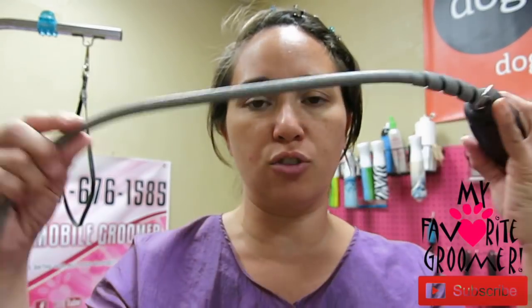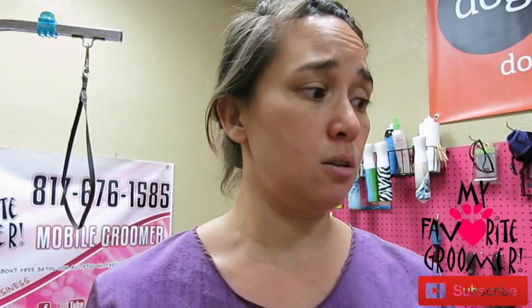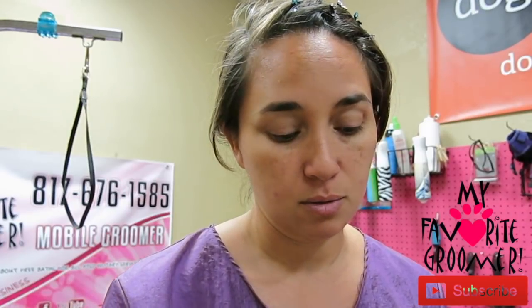I believe in the 5-speed because of the weight and I can get through the day grooming - I have yet to have a problem with any of my 5-speeds. I did take the time to put this original monkey cord on here. I found the original one and went and supported that company. Cord your clipper - put this monkey cord on, make it as close as possible all the way down, starting right at the base of your clipper. Take this original cord out first before putting the monkey cord on, otherwise you will destroy the clipper connection inside by flipping it about 300 times. If you do not take out this cord when you do the original monkey cord, you will bend the hinges and connectors and have to replace it - replacing this cord was 30 to 40 bucks. We did it right the second time - took the cord out, then corded it with the original monkey cord.